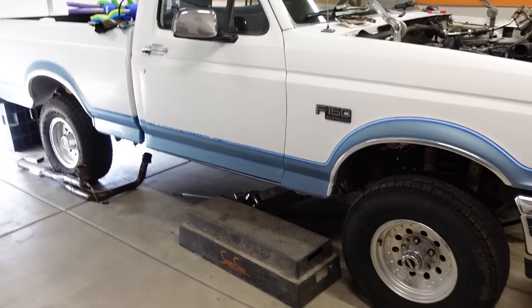And all that's going to come probably later on this winter. But if you've watched the last couple uploads I've done on this truck, you'll remember that the big issue that we had that kind of stopped progress for a little while was finding a correct flex plate that'll mate up this internally balanced 408 Stroker Windsor to this E4OD transmission.